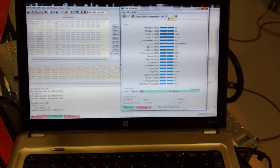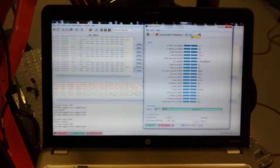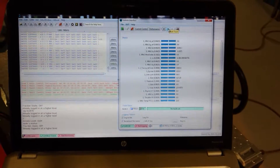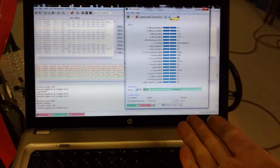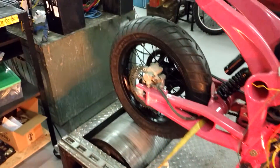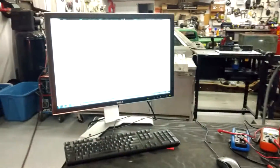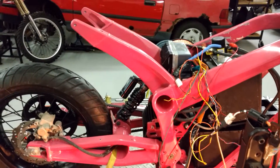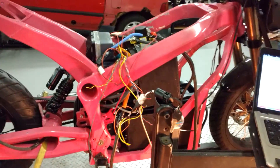I went into the Microsoft Excel spreadsheet and looked at the data log that I did with this window here, and it actually showed 476 in the software at the same RPM. So that current sensor for the dyno is probably very accurate, or extremely closely calibrated — I'm not exactly sure if Sevcon measures their input current or if they calculate it, but it's so close I think I'm going to call that good.